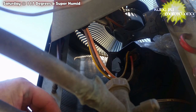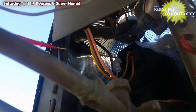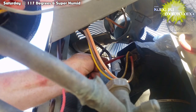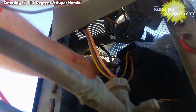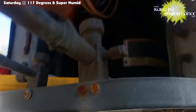These units are tough to get into — it makes it just a pain. Here's the black common lead. I'm going on the end of the lead, doing a continuity test from here. No continuity. We should have continuity. So now I'm going to get just behind it and get just the wire — the lead on the wire.